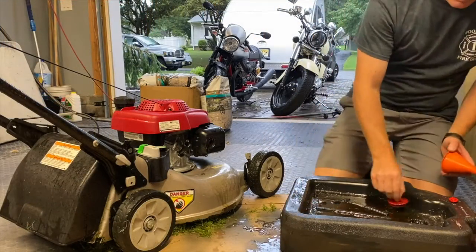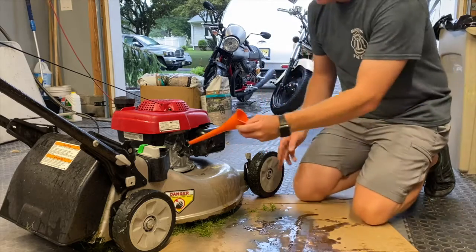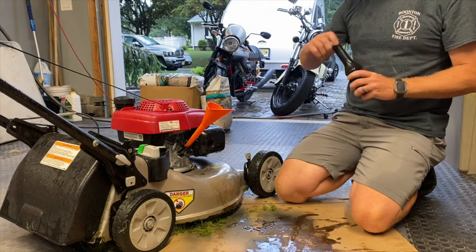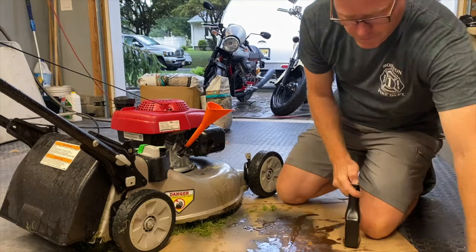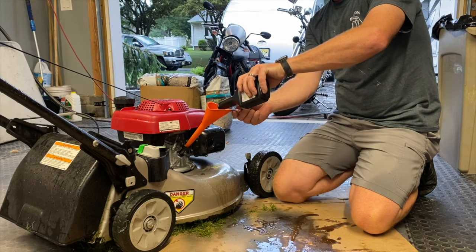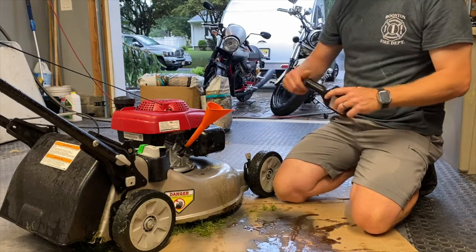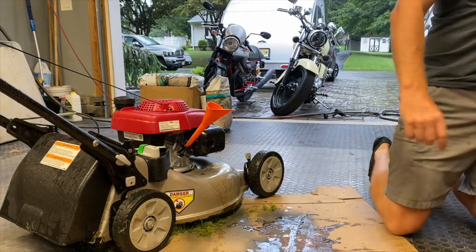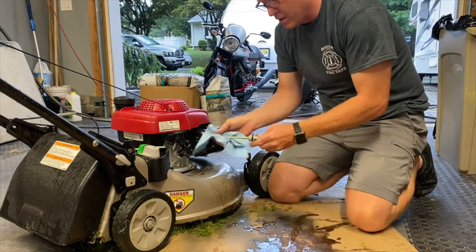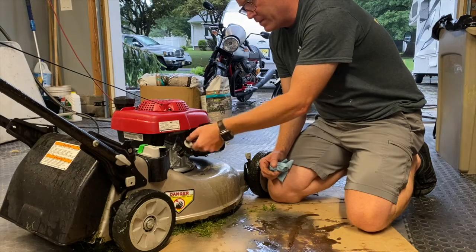Now the oil has drained out into my bin. I did spill some but I have the cardboard for that. You just take the Honda oil — this is the right amount to go in — open it up and pour it into the engine. You do need a narrow funnel for that. Once it's all out of the funnel, clean the funnel out. Then check the dipstick — it has some knurls at the bottom and you want to be at least at that level. Tighten it up, pull it out — voila, new oil.